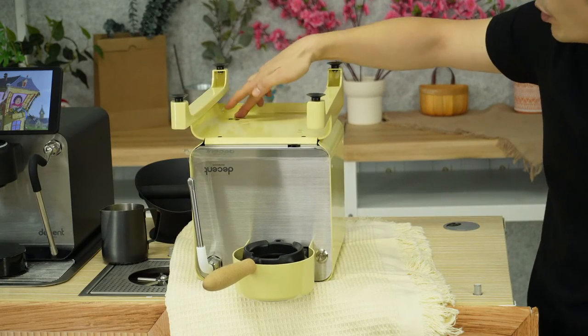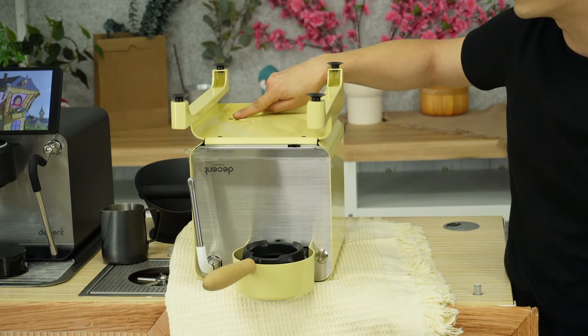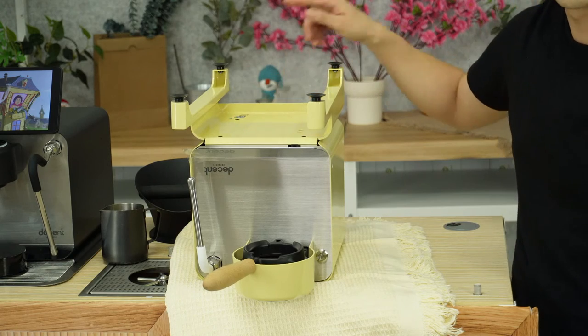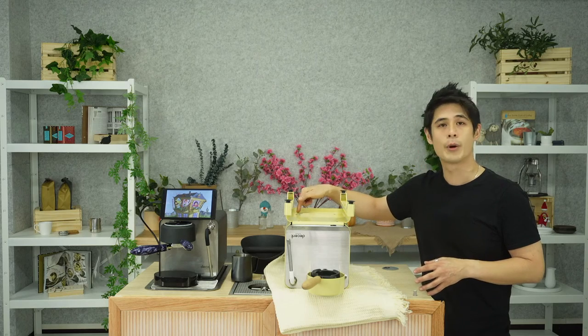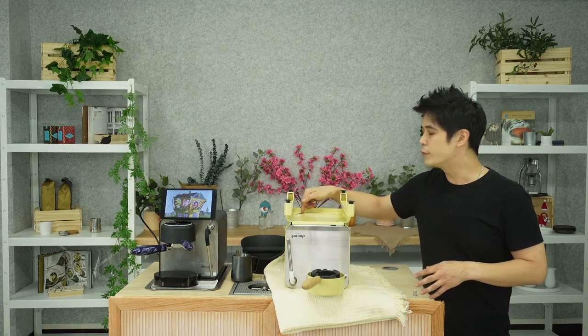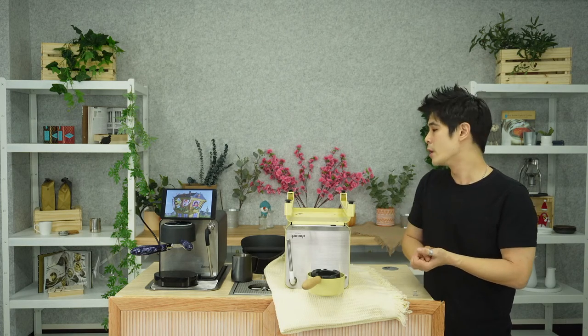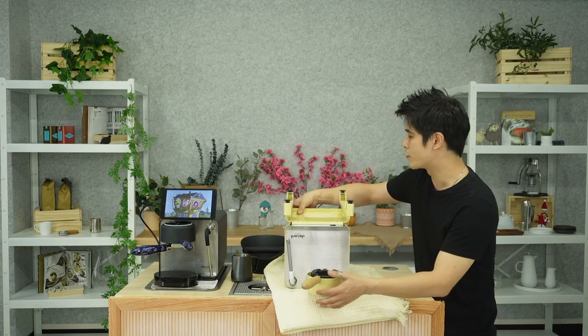Now that the new filter is in, you'll find it's almost flush — a little bit above the chassis. This is a good talking point: you'll notice it has pillars at the bottom. The new filter was designed so it would lean on the base of the water tank, but not flush, so that when the pumps work it wouldn't interfere with suction. As long as it's in properly with a little bit of protrusion from the chassis, everything will be fine.